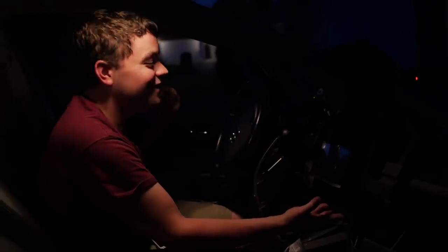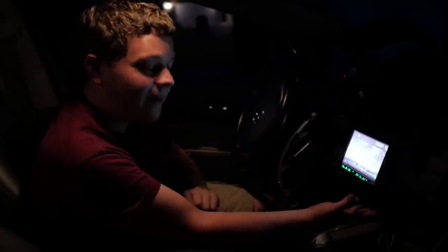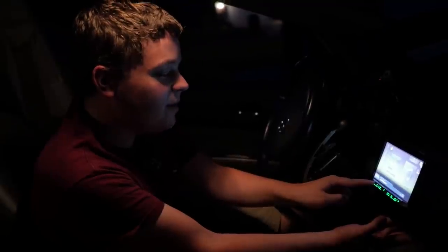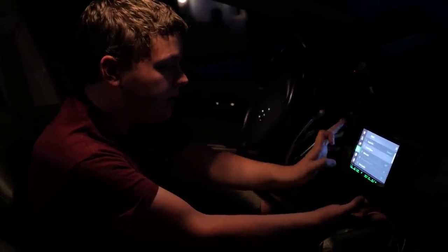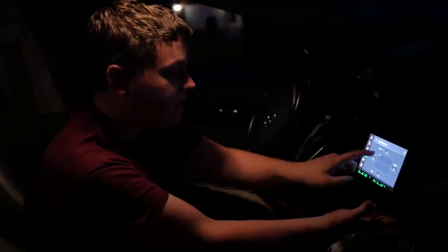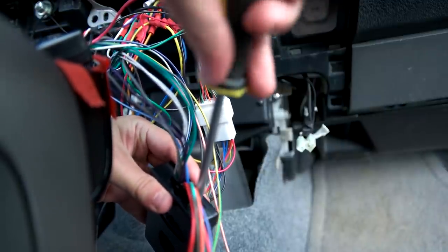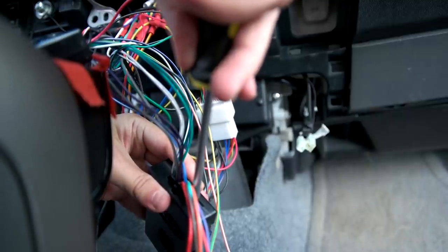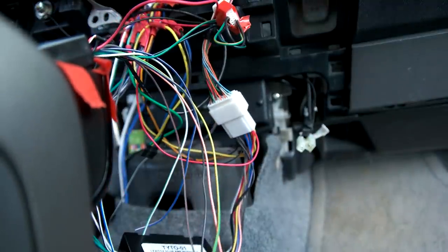Now we can fire up the car. Everything should work just fine. Let's go to a station. I was able to go in and test each individual speaker in the car and hear the changes. The interface also has a volume dial you can adjust with a screwdriver. You don't want to turn it up all the way, otherwise you're going to peak your speakers. Likewise, you don't want to turn it down too much, otherwise you're going to hear a lot of noise when you turn up the stereo. Note that there is a significant delay when adjusting this dial.